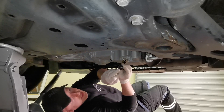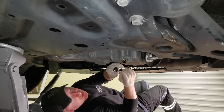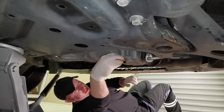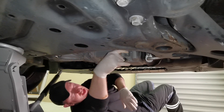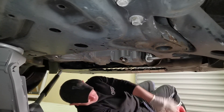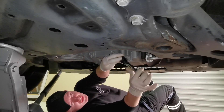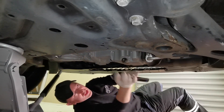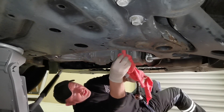If you have a copper-type washer or a crush washer on your sump plug, you'll want to replace that. This one has a rubber seal — I've checked it and it's okay to reuse. After the service, once it's all topped up and levels are good, start the engine and run it for a while to make sure you have no leaks from your oil filter or sump plug washer. Just a few minutes of the vehicle running will tell you if it's all good.